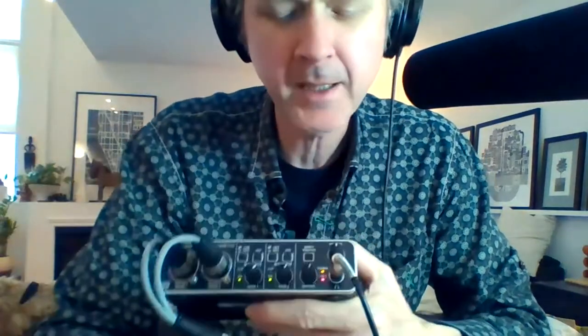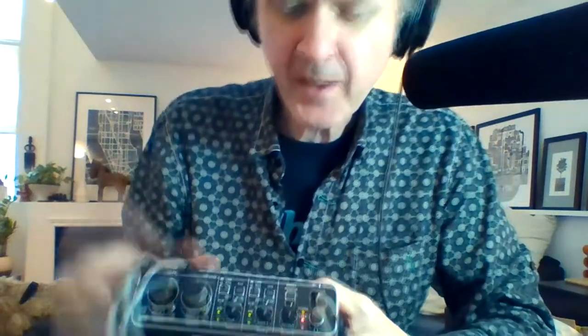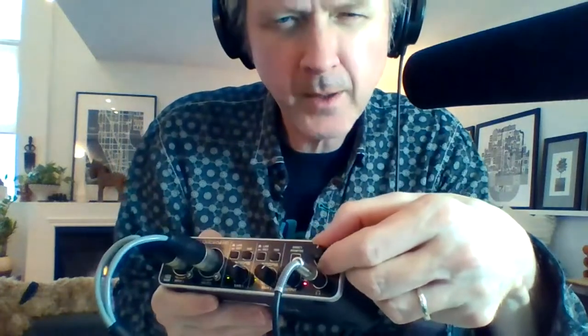Going into one of the channels here, it will work. If you're getting left only or right only, you might have to split, but I don't think that's the case with Zoom — I think it's summing it all to mono. This little box has a couple of options on front. I'm using line in, not instrument — just find the best setting that works for you. On the back it's got phantom power, so you can select phantom power for a condenser mic. The shotgun microphone is a condenser microphone — turn the levels up until you can hear them. You've got the headphone output jack so you can hear what's going on. With the Zoom software, you simply select the microphone. If you plug the USB in before you start the program, it'll give you all the options of what microphones and speakers to use. You can just work with those settings and test them yourself.